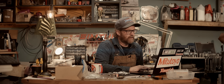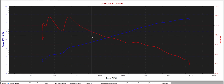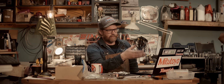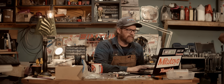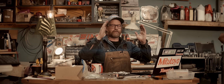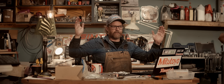Because what was going on here was we started with around 11:1 in gear ratio, and we ended up closer to, well, 8.7. This doesn't matter for the power numbers because we're running versus RPM and we're using that sensor. So the power numbers are correct. The curve isn't though. It's more stretched out than what it should be. So the power spread looks wider than it is.